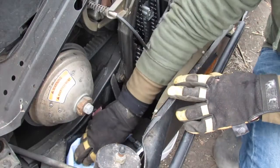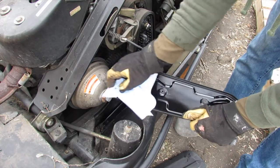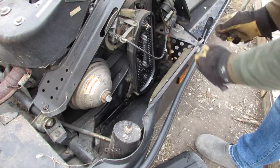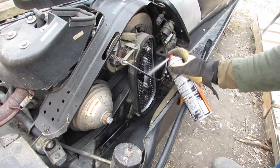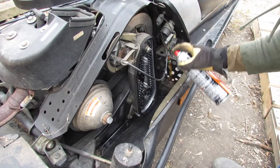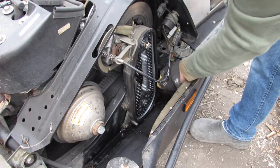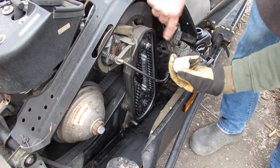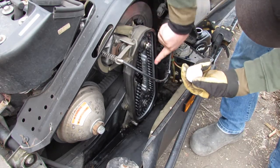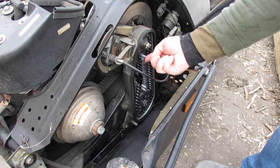Clean the oil in the belly pan with shop towels. Wipe down the chain case cover. Remove the dried gasket material from inside the chain case. Clean the inside of the chain case with brake cleaner. Reseat the chain case gasket as it was probably dislodged when you removed the cover. Put a light coat of oil on the gasket. Put a light bead of gasket maker on the inner chain case cover mounts.